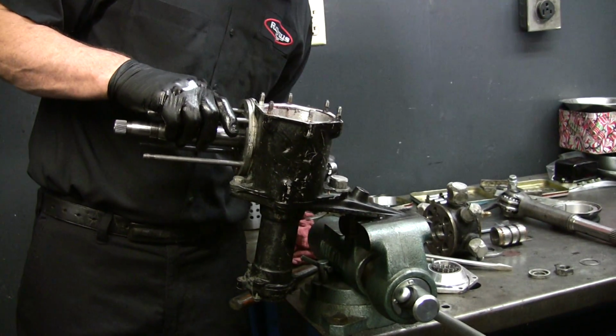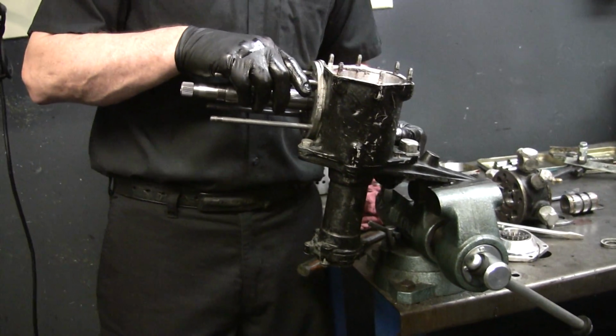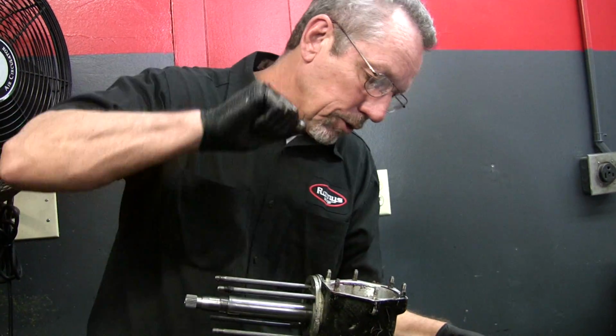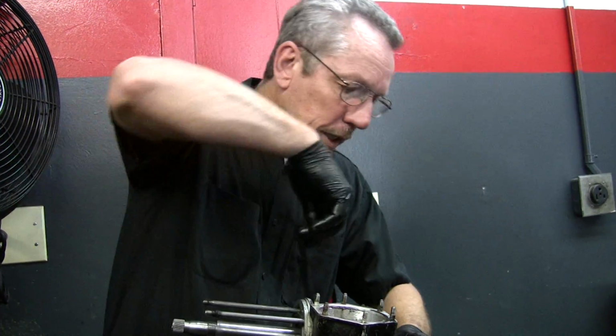The Cloud 3s had a real bad shudder problem because they upped the boost and made it more sensitive. So with the Cloud 3s in the parking lot, a lot of them will have a little shudder in the steering. It's really disconcerting. So I changed the fluid, and then they made a modification kit for the fittings out at the steering ram that reduces the orifice. So less fluid goes through and it doesn't go as fast. You still have your assist, but it doesn't go as fast. So I usually just braze up the fittings and then drill a 100 thousandths hole in both fittings.